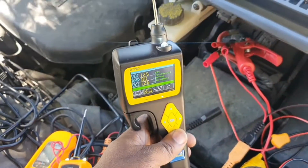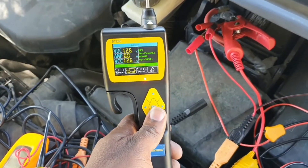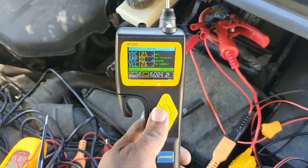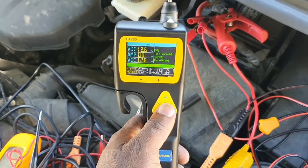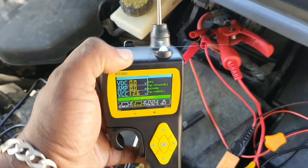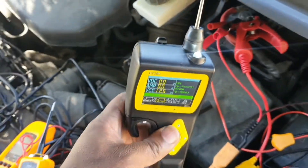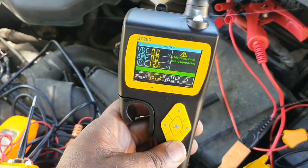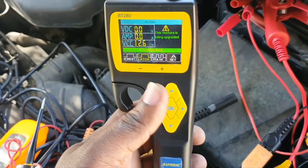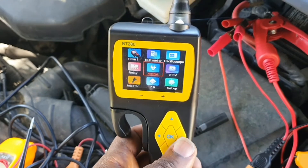One thing to note on this unit — there was an issue with the circuit breaker. If you accidentally short the tip to power, it can damage the injection circuit, which is what happened to my first unit. I could hear the relay clicking but it wasn't actually sending power, and the 'fault' readout was always showing zero current being supplied. Also, on this model the ground injection function is not available — possibly a software issue listed as 'features being upgraded' — which is pretty annoying.